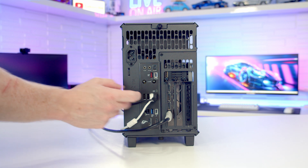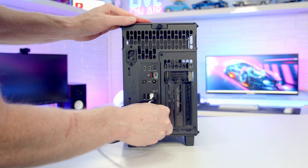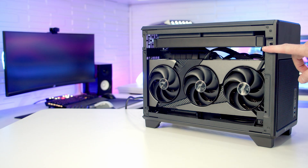The CPU I'm using does have integrated graphics, so let's test that out. If we unplug the HDMI cable and plug it into the motherboard and try again — looking over at the monitor, we have got a post. So this points to a problem with our graphics card.